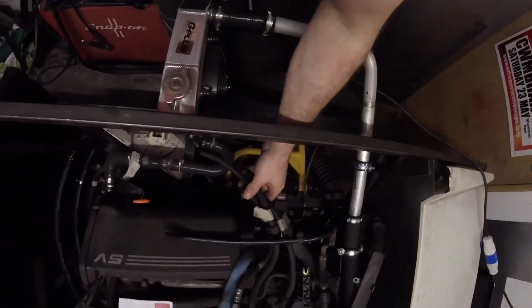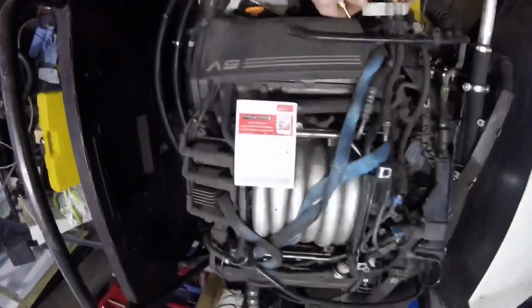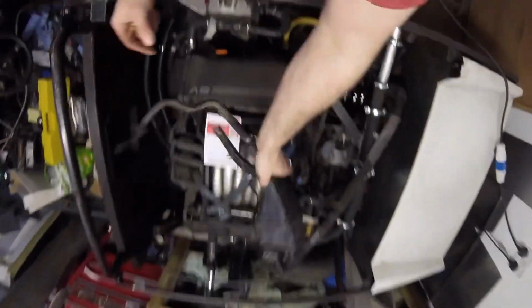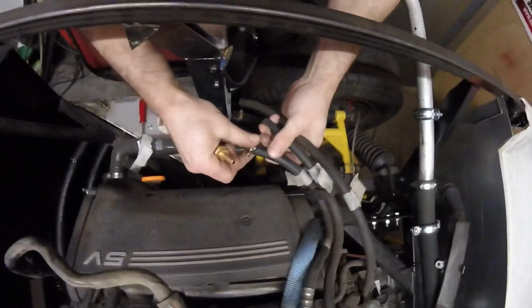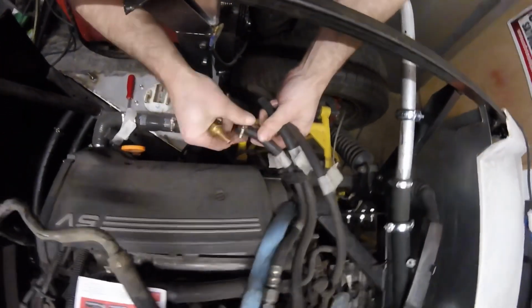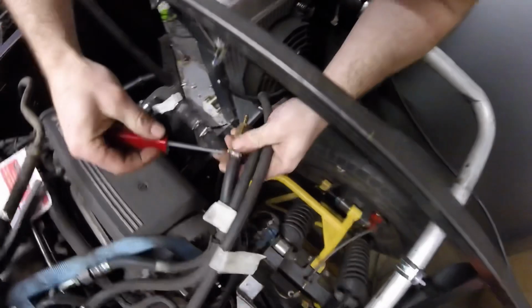These are our three fuel lines, and fuel line one is the return. So that'll be going on to that one. And then two is the engine off there. And then that one goes on the solenoid, which is on here, which goes onto there. So we can get these on. Put these fuel lines on. Let's get them on.